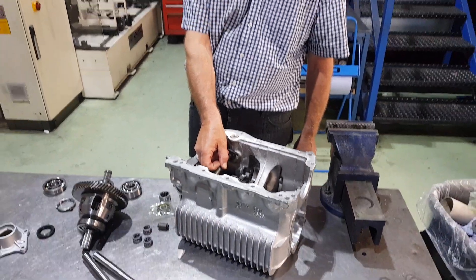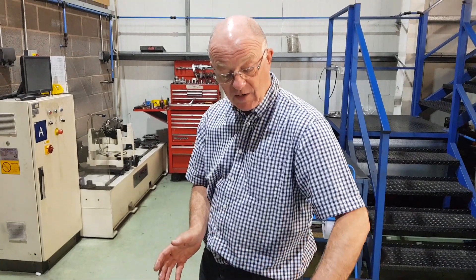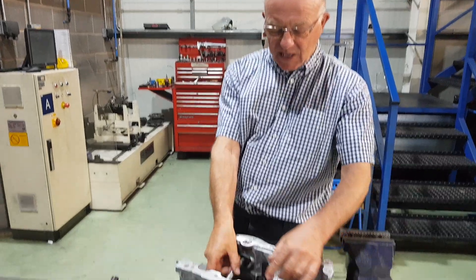It's a must if you're thinking of driving quick — going round roundabouts, round tight corners. Because what happens is if you go round a corner that way, the oil surges to that side of the gearbox and the standard pickup pipe is in that side of the gearbox, so you get no oil pickup. Therefore you get no oil to the crankshaft and you knock the big ends out. That's what happened on my mini stock oval racer many years ago — right-hand corners, the oil light came on and it was game over in the engine. So: central oil pickup pipe.